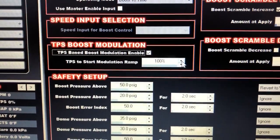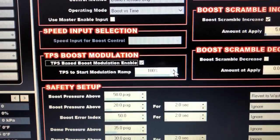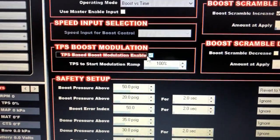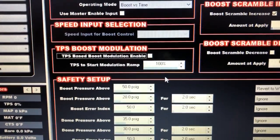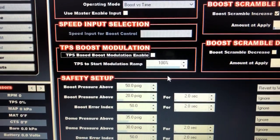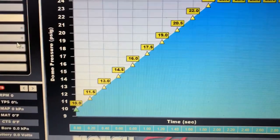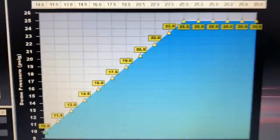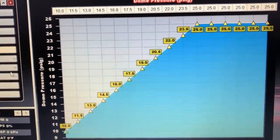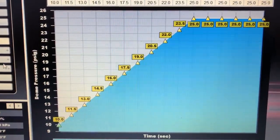The good thing about this scenario is it would be good for the street — really good to conserve CO2. But for my car, I do not have this selected. With that not selected, basically anytime I turn on the ignition the solenoid cycles and puts the dome pressure on there. It follows the ramp — this one starts off at 10 PSI and then ramps to 25 PSI at two seconds. So it'll just have 25 pounds of dome pressure at all times, as long as my quarter-turn valve is turned on at the bottle. That's the way I do mine.